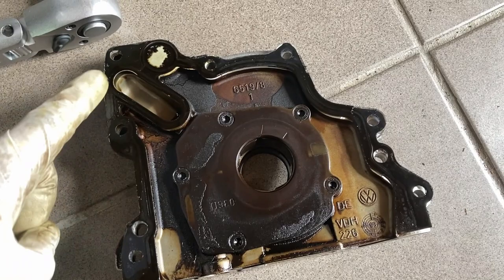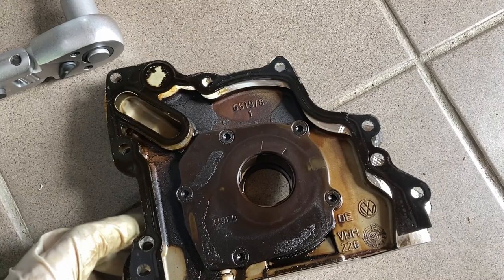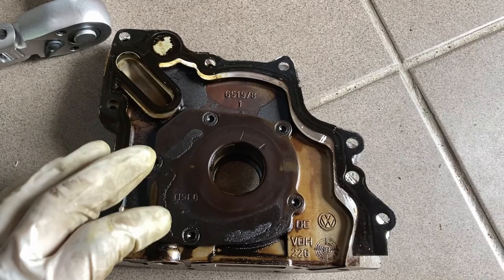There we go — from our leaking oil pump gasket. Out. There are two positioning alignment pins here and there — just wiggle around a little bit, you don't have to be very aggressive. The gasket needs to be replaced. Just some paint coming out here, but anyway — 22 years later, I think it's worth replacing.